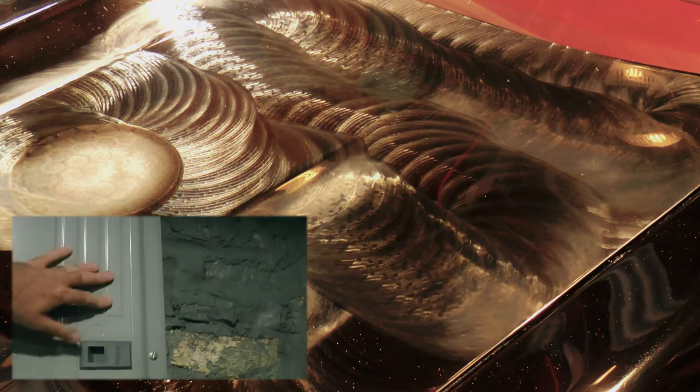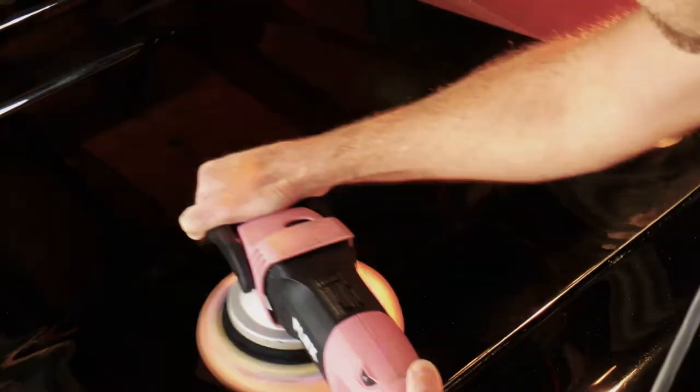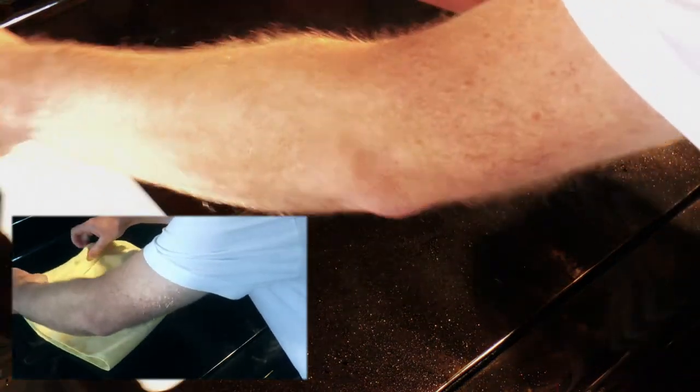Scratch Swirl Remover's 2000, so understandably, I've been jonesing to use this product. Press firmly on your passes, and remember, don't overthink this. It's not as difficult, and since we're using hex pads, it's reasonably safe. And use your 10-to-1 water alcohol spray to assist in wiping this down.